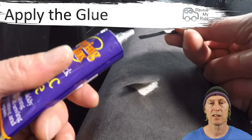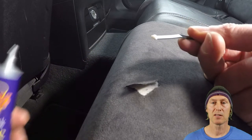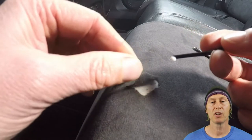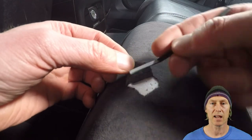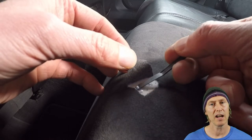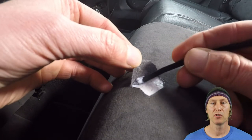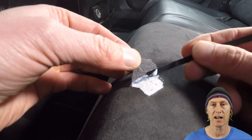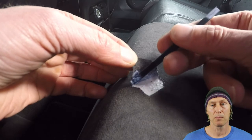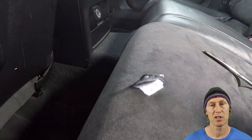With that done, we're ready to glue the torn piece back into place using fabric glue. Here I'm using a small piece of zip tie as an applicator for the glue. I'm applying the glue to the seat base first, making sure I get it on nice and evenly and all the way to the edges — and if the edges have lifted slightly, even slightly under the edges if possible. Next I'll apply the glue to the underside of the torn piece of material in exactly the same way. You need to give it a good coating so that it soaks in, but avoid applying too much because it'll squeeze out excessively around the edges when we put the piece of material down.